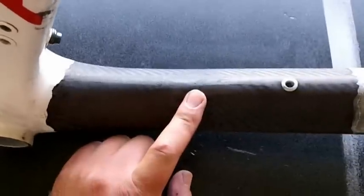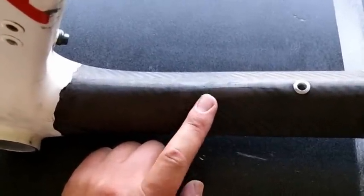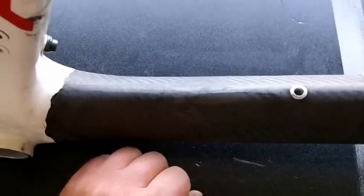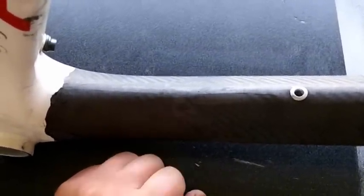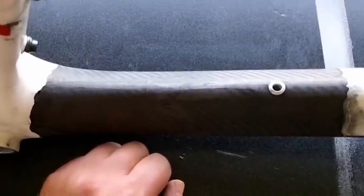So all that's really doing, like I said earlier, is helping to keep the air from circulating from the inside of the tube up into my vacuum bag. And so just be careful not to squeeze on that or think that this is structurally strong after adding that glue in there, because it's not. We have to add the carbon fiber.